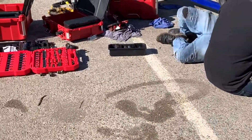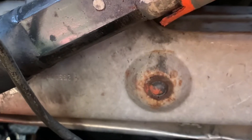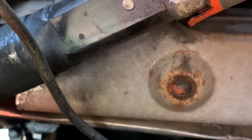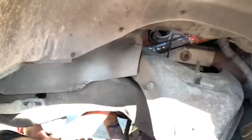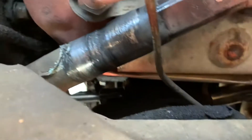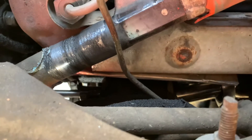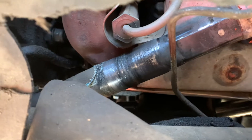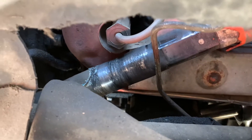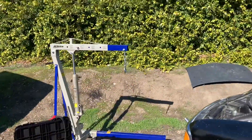Look at the way the mount is moving - you see it's still tight but it just has so much play. It just goes up and down. Yeah, they're done. That mount moves up and down - look at the steering rack yeah. This is what's happening.